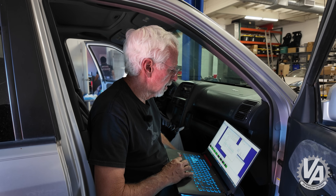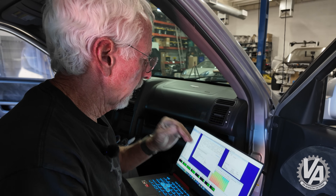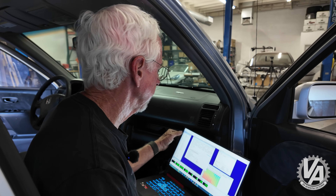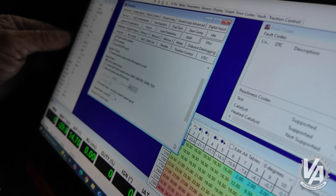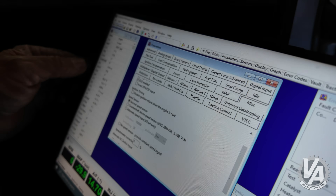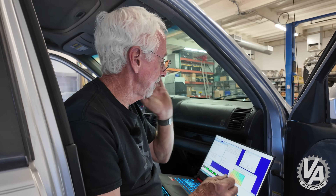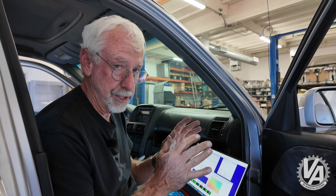We looked at a TSX stock calibration since it's a TSX motor with no header. We opened it up and looked in parameters to see if we have the ability to make changes to the intake manifold runner control solenoid. We have choices on different speed inputs and outputs, but nothing for the intake manifold. Let's try a different base program. If you're using an ECU that has the intake manifold runner control solenoid and you leave your reverse hooked up to that, it will work like OE — all you have to do is put in a Type S program. I found a stock K24 TSX Type S program, and that's what we're going to load into this computer.